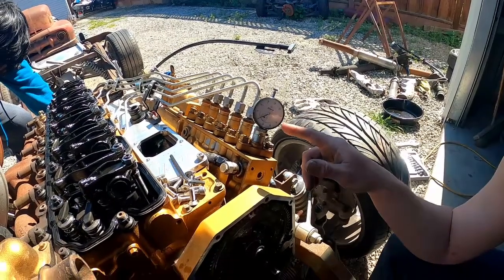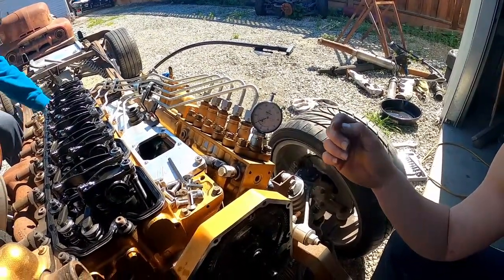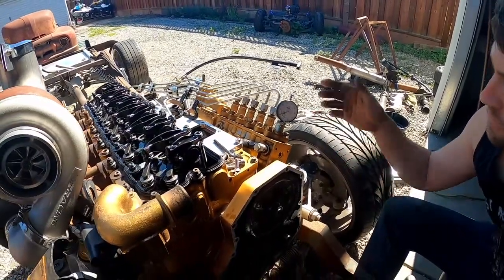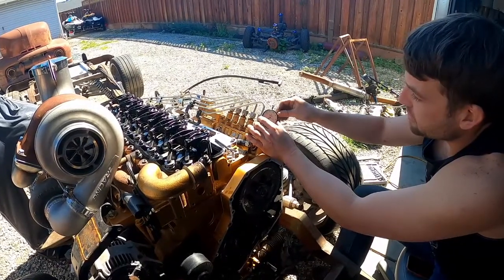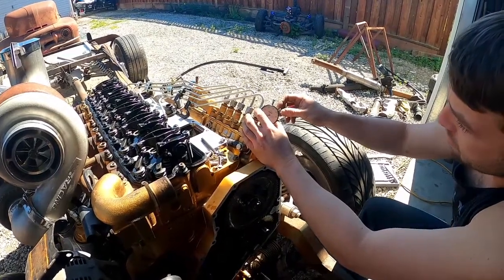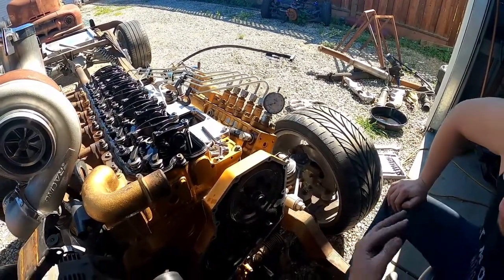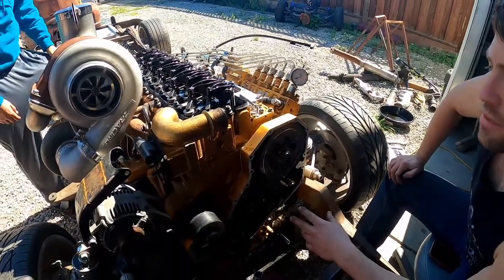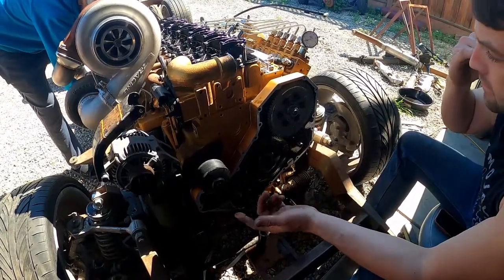See, the needle stopped moving — go ahead and stop. Basically all we do now is zero out your dial indicator. Mine's already zeroed out; yours will probably be sitting somewhere depending on how you have it set, but just zero it out. Then turn the wrench to the opposite setting and rotate the flywheel counterclockwise, which will rotate the engine clockwise.